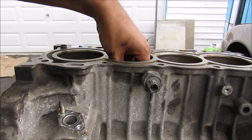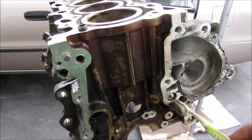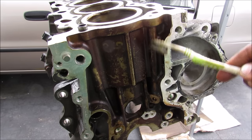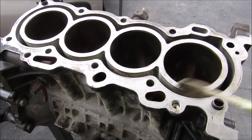While the oil lubricates the cylinder, excess oil will drain into the piston back down into the sump. That main oil galley that runs along the length of the engine is blocked off by this steel ball here during manufacturing. It also branches off over here to an oil galley that goes up to the head. This hole is where the oil goes into the head, and these three holes are where it drains back down into the sump.